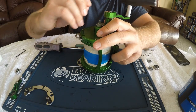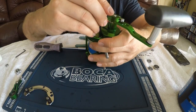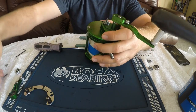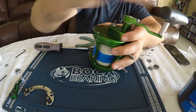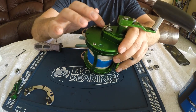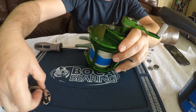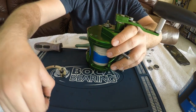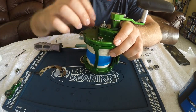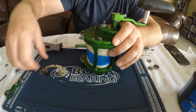What I like to do is crosshatch these — put this one in just snug, not even tight yet, just enough to hold it in place, then go complete opposite so that everything tightens down evenly. Double check all these, make sure they're where I want them. Now what you want to do is put some grease here. You can use your finger, you can use a brush — whatever works for you. Take these space washers and just put them there; the grease will help hold them in place. It also prevents corrosion and stuff from getting in there, so it's a good thing to have.